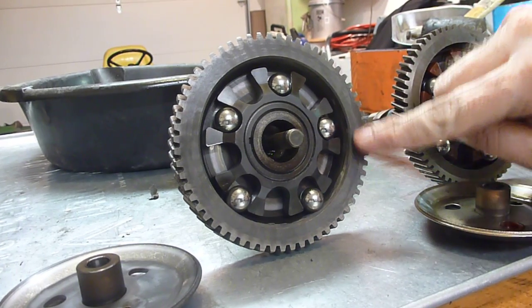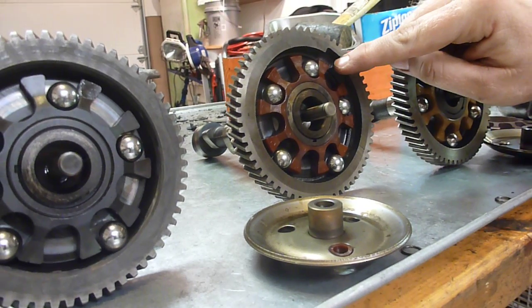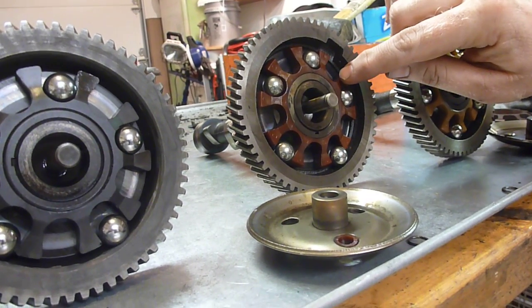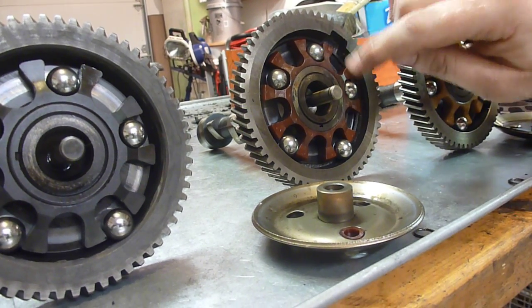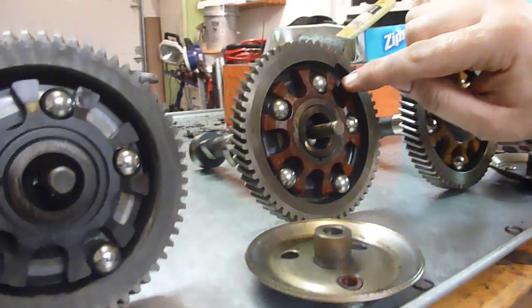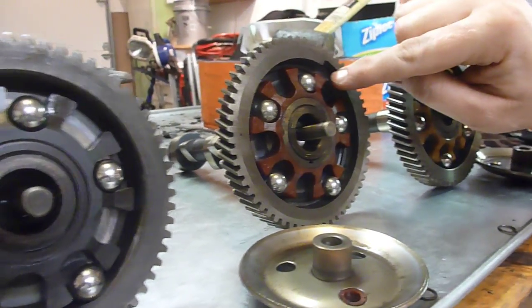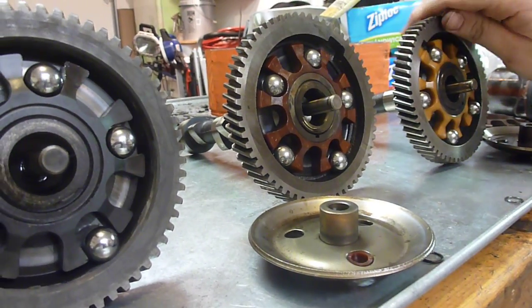There's also no little notch in the cam gear like we have in this one from 1987. What we have here is a plastic flyball spacer that's glued to the cam gear, with five ball bearings. And on top of that there's a little notch, but nothing protrudes into it — so there's nothing to stop the plastic flyball spacer from spinning.